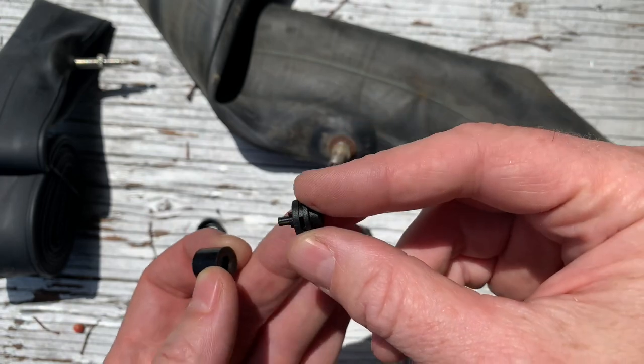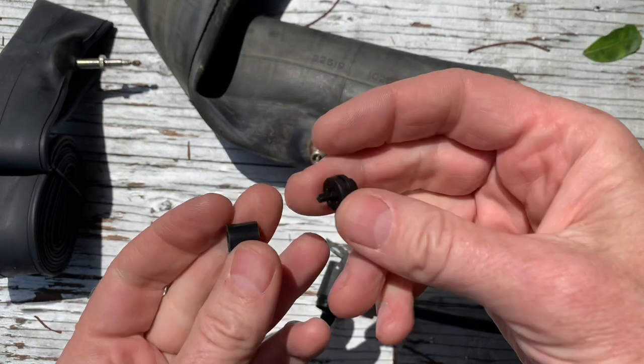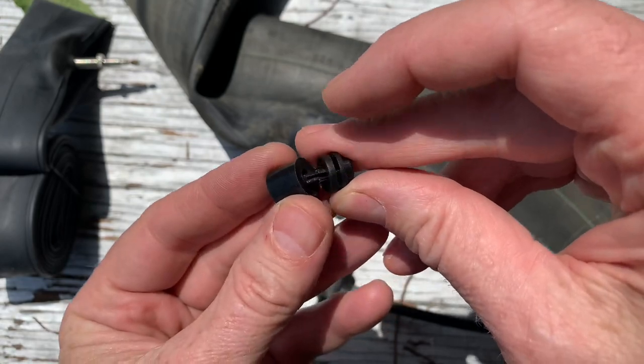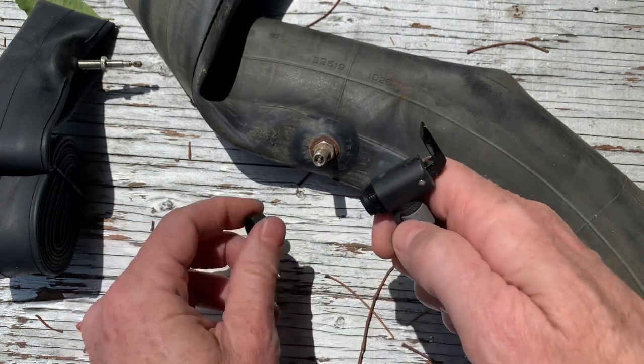This piece has a circle on it which you'd use for the Presta valve, and it's got a poker that you'd use for the Schrader. You need to put the poker so that it pushes down the little nipple in the middle to let air in and out, and so that it has a big mouth sticking out towards the tire. Once you've got the poker and the big mouth oriented correctly, put those two pieces in and screw the cap back on.